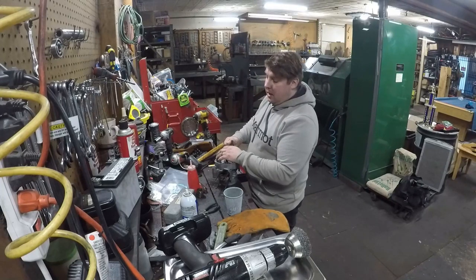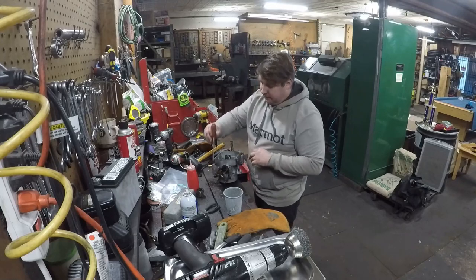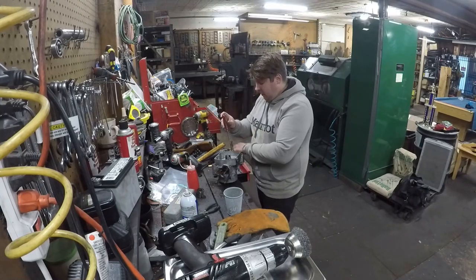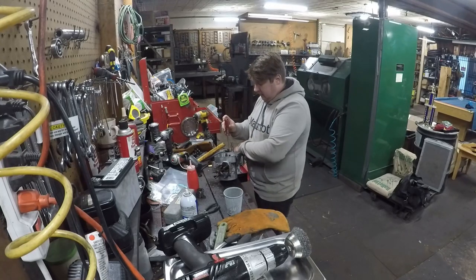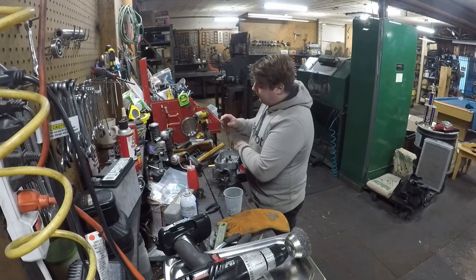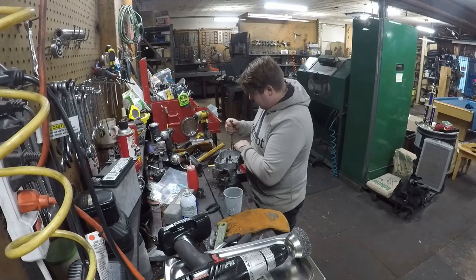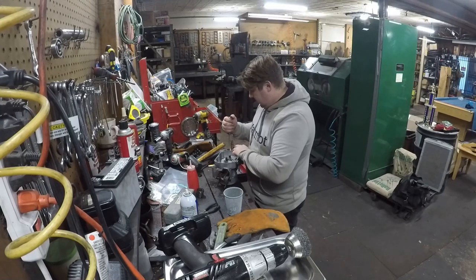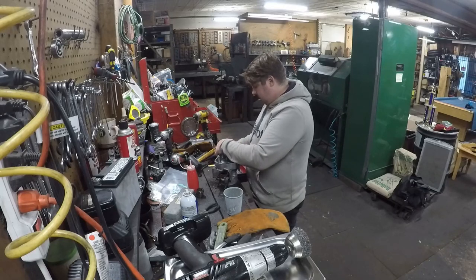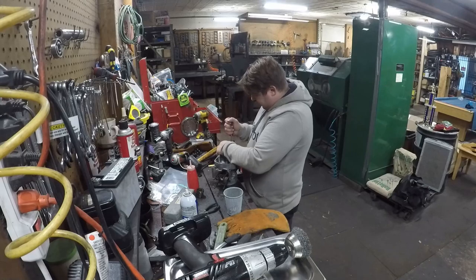Okay. So for those of you unfamiliar with Garellis, the reason these are on here is because the mounting points are all rubber. So this allows the motor to ground itself to the frame, so you don't fry your points or whatever, because the cases essentially are just floating in space, unconnected to the ground, like the literal ground. And yeah, that will cause you some issues. So make sure you leave this little guy on your case.